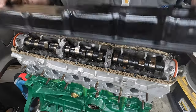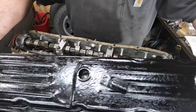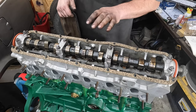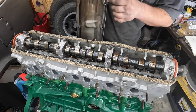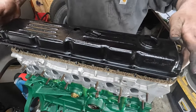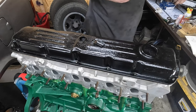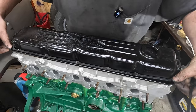As for the cam cover itself, this paint isn't quite up to the standards of normal Baked Beans Garage — we've got more fish eyes than a whole shoal of blue tangs. I gave it a quick rattle can job to look nice for the thumbnail. Also, I'm not sure the D24 ever got a cast cam cover, but if you want to put a cast cam cover on the Volkswagen four-cylinders, you're going to need to use a later over-molded rubber steel gasket, because these stamped cam covers have a little lip on the edge that holds the seals in. If you use these gaskets with a cast flat-bottomed cam cover, it's going to push those gaskets out and it's going to leak. Going to throw a few nuts on to hold it in place when it goes upside down.